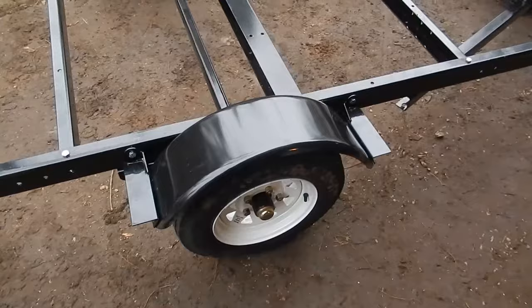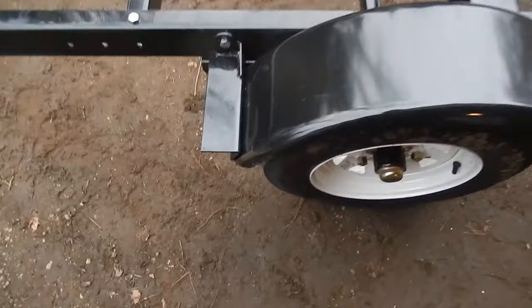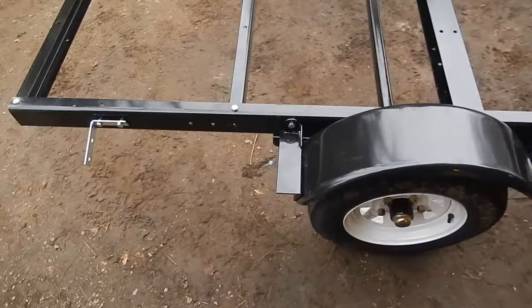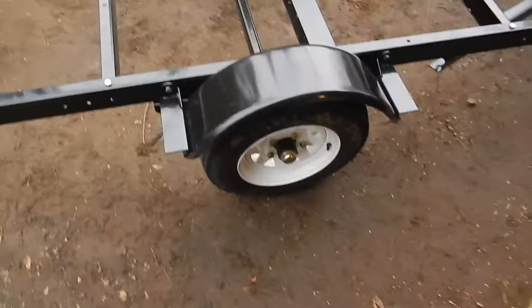Same deal. Just put them in with the bolts loosely, then tighten them all up so everything lines up. They went on fine. The only thing that I think I might do, these are some deadly corners. And you know that you're going to walk into that when you're strapping down a load one day. And if you're wearing shorts especially, you're going to regret that. So I think I'm going to zip those corners off with my angle grinder when I'm done, because I know I'm going to walk into that and it's going to make my day into a bad one.